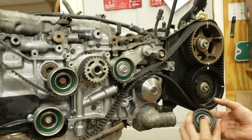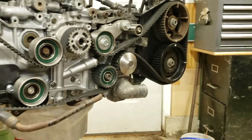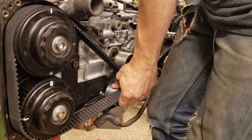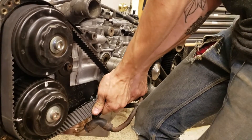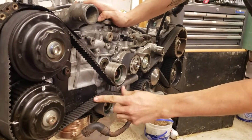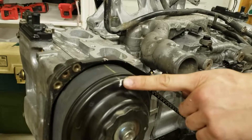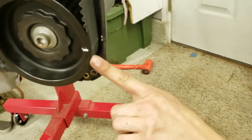Now this part can be a little bit tricky. That's hand tight. So now what I'm going to do is pick this up — you're going to have to pull hard. I'm standing on top of the engine stand so I don't pull the motor over. Then slide it over. And that is timed. I'm going to go back and check your marks — this one's lined up, this one's lined up, our crank is lined up, this cam is lined up, and this one is also lined up.